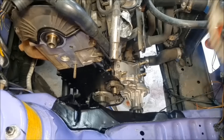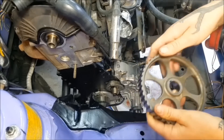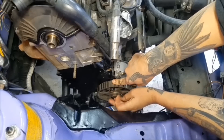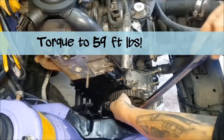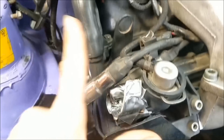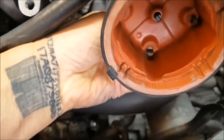Now that my water pump is on, I can go ahead and put my auxiliary shaft pulley back on. This is the exact same pulley as the cam pulley — it has the exact same part number — so if you mix them up, no big deal. This is keyed, so I'm going to use my 13 millimeter socket on that bolt and my 18 millimeter socket. We've got to put this in position, and the direction actually does matter because this runs our distributor. We've got to face it towards cylinder number one. You can follow that spark plug wire — it's right about there, facing towards spark plug wire number one.